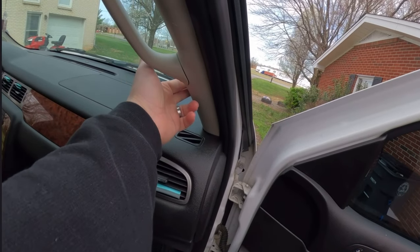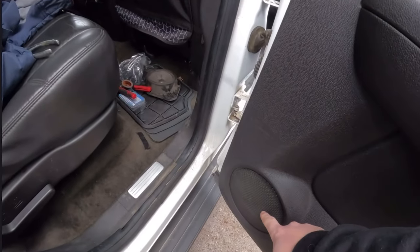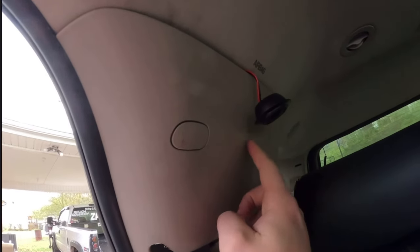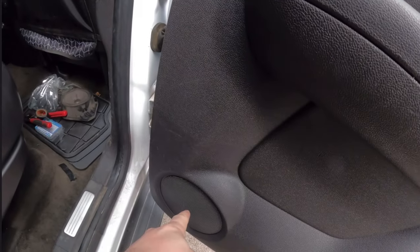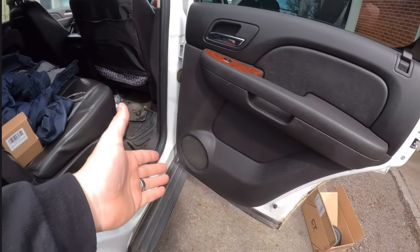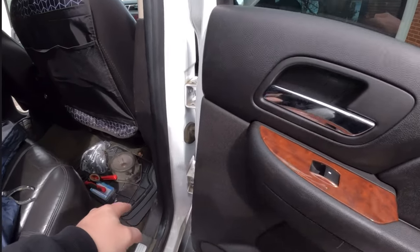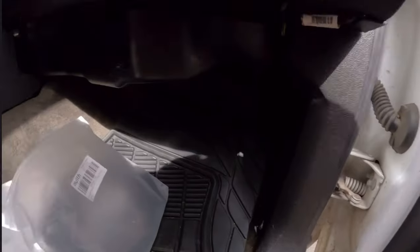The speaker's already in there and it already looks good — you can't even tell — but they sound incredible. The difference between that side and this side is night and day. I'm still using the factory tweeters on one side. The back speaker is already replaced, and I ran the component crossover wiring up through the door so I can access it without pulling the door panel if there's a connection issue. There's a little pocket in the door that fits the crossover perfectly.